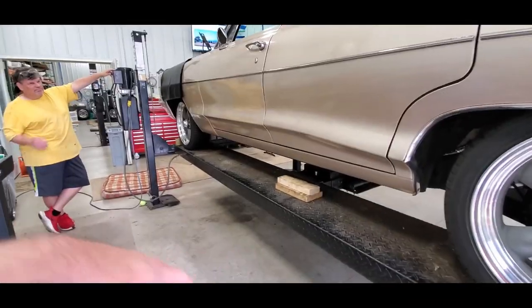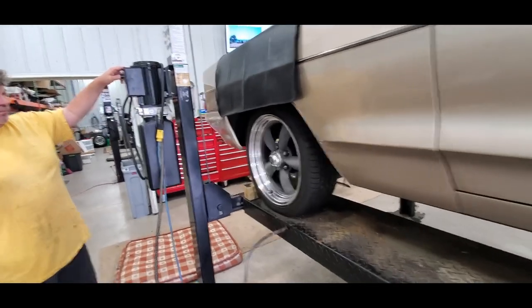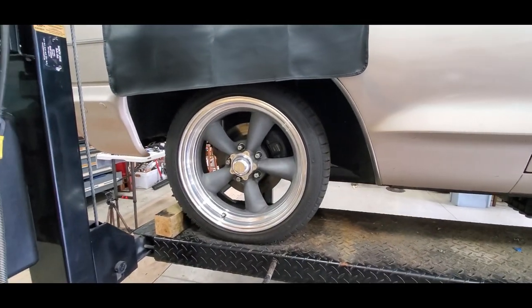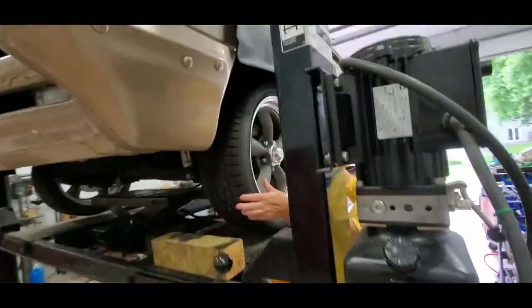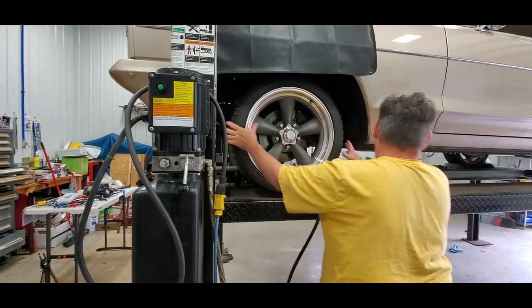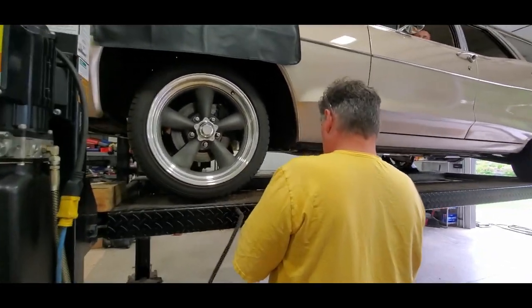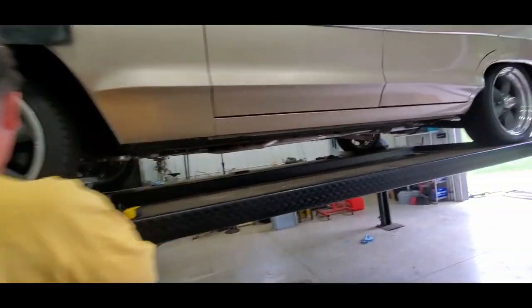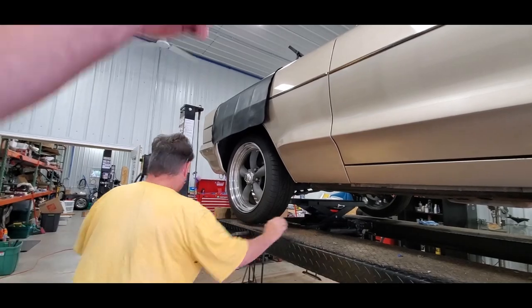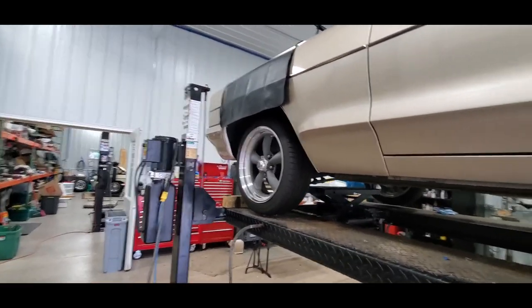So we left Pixie in. We're just gonna slide the jack forward, pick the front up, spin tires, and have her slam the brakes and make sure those actually work, because we don't know. Okay, that was successful. Okay, so the next thing we're gonna do real quick is go ahead and bleed the power steering since we're up. So Pixie can start her car, do not go into gear, and just slowly turn left, right, from lock to lock, nice and slow.